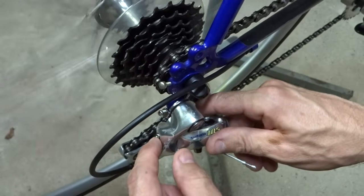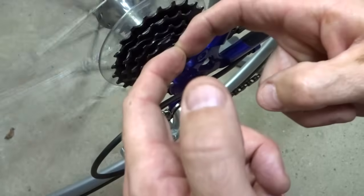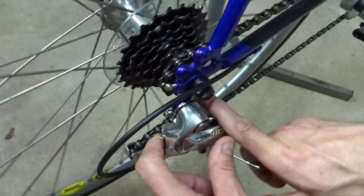Now, if it won't come all the way over this way, it could be an issue with the high limiting screw, in which case I would loosen that and see if that allows the chain to come over. I have a video on how to adjust the limiting screws. I'll include a link in the description of this video.